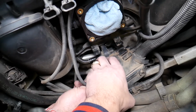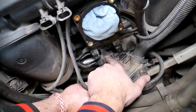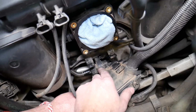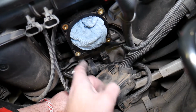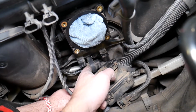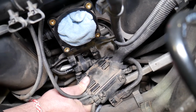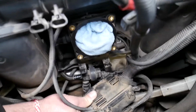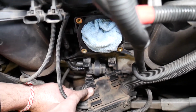Now if you look at it underneath, this is where your purge control valve is located, right underneath. It should have two lines, one that goes from the purge control valve to the intake manifold, and one that comes to the purge control valve. If you want to see how to test them, we'll have a video on the channel, and we will try to share the link in the description of the video below as well.